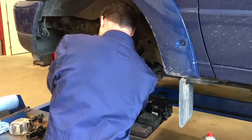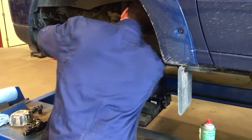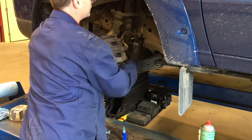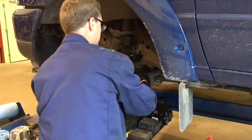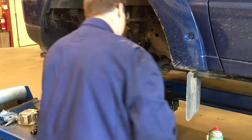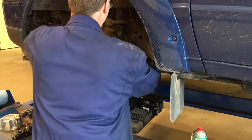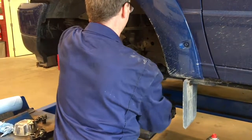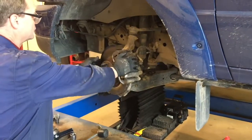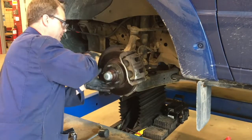We've got it threaded in. I'm going to take this down initially with a ratchet and then torque them up. It's really important to torque these to the proper specification — every vehicle is a little different, so always look up your spec requirement and go to a proper technical site. Using a click-style torque wrench, pull nice and gradual on it, not a quick motion — a nice steady pull so you get an accurate torque. Now I'm going to straighten out the wheel, check the backing plate, make sure it's away from the rotor. Rotate the rotor, check backing plate clearance, and make sure there's no rubbing.